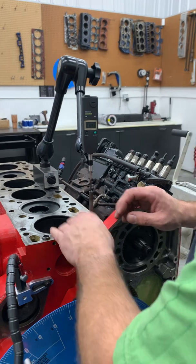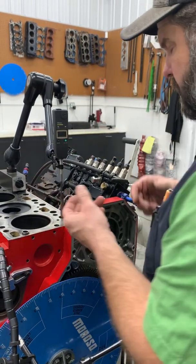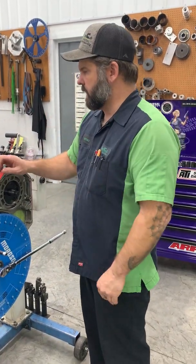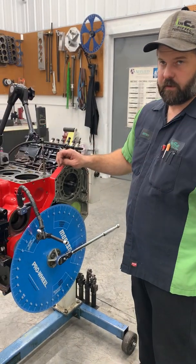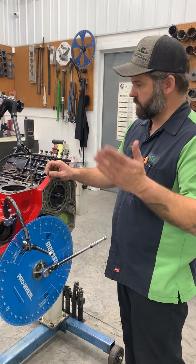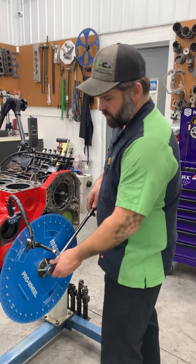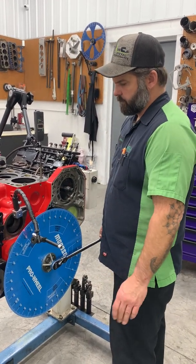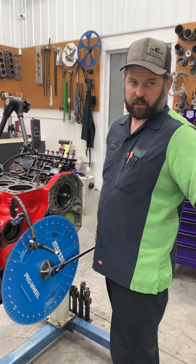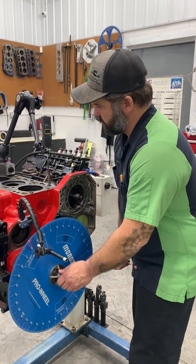So just like with piston dwell, your camshaft, especially on a flat tappet, has quite a bit of dwell where it holds that valve at max opening. So you're zeroing at dwell and you're going 50 before and 50 after because you're getting past the max lift where it's dwelling and checking on each side of the lobe. A lot of people regard center line as not a very accurate method. That's why we check both ways. So we check the cam card for opening, closing, and center line. But center line gets you in the ballpark pretty good as long as it's done right.